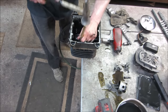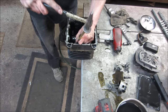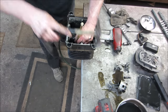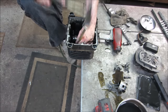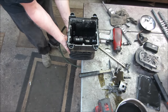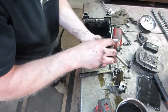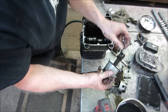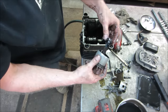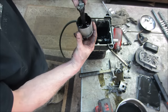Make sure it's off the bench all the way — it's going to fall on the floor, but hey, there we go. Gotcha. The wrist pin blew right out of it. That's probably where all the play was coming from right there. You think that's the problem?